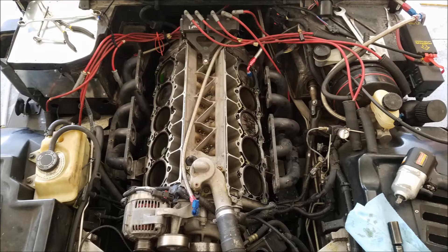What I was going to do was port the heads, redo the fuel system, put on some better rockers, and do some bigger throttle bodies — all without having to pull the motor. I could have done a cam at this point, but doing a cam would have meant taking the motor out, which I really wasn't willing to do. I got quotes of around seven grand to pull the motor, put a cam in, and do heads. I could have saved some money doing it myself but I decided to skip the cam.